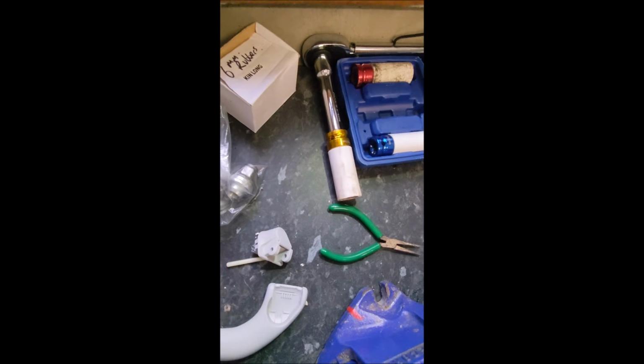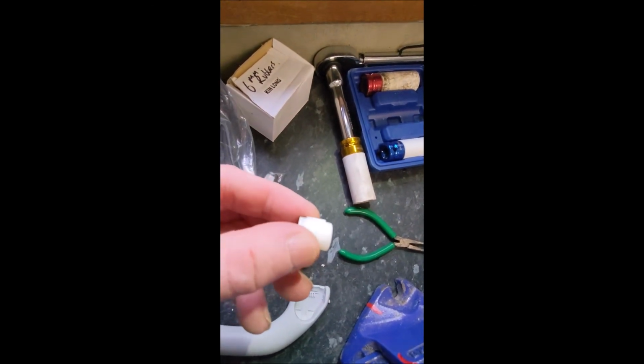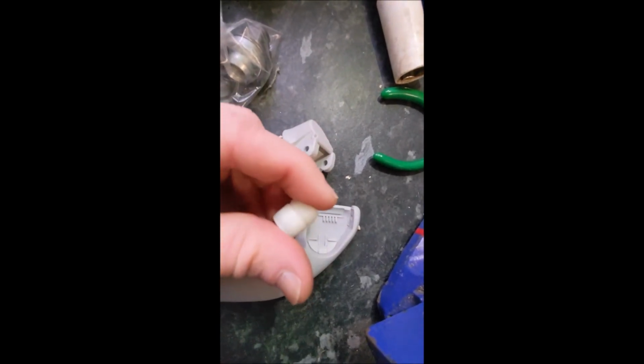The actual dampening mechanism itself has, if you can see that bit, a little rim along the top of it. That rim effectively goes into that little notch in there. So all you do is reassemble with the damper, with the notch in there like so, with the pin through it and the hinge back on, and you just literally pop it back onto the car.